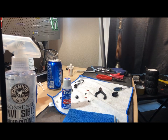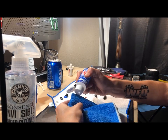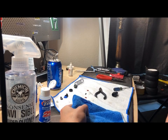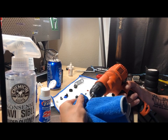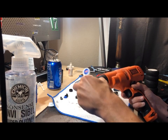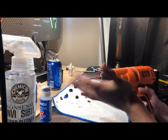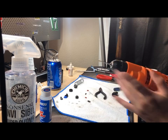What I like to do next is take some metal polish - any metal polish will work. Just run it through there. What that's going to do is pull off all your contaminations, the oils, all the dirt, et cetera. Then just get it spinning again, get a little more speed on it, and wipe it all off. And there you have a cleaned and polished shaft. Now take your shock fluid - on this it doesn't matter what weight - run it on your microfiber towel, get it nice and good on there. This is basically re-lubing it, kind of like you would a camshaft if you're building an engine.